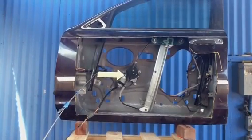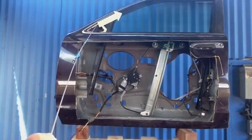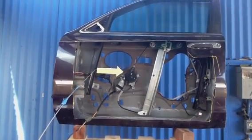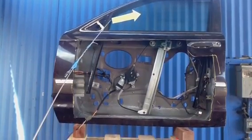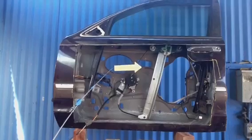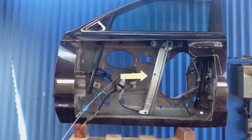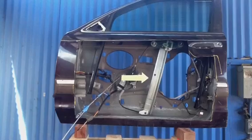What the chip does is count the revolutions of the motor as the glass goes up, learning how many revolutions it takes to reach the top. Once it gets there it remembers, and from then on it rolls the glass up to that exact height. It also has sensors so that if you or a child puts fingers in there, it stops and won't pinch them. But when you reinitialize, you have to go through what's called an algorithm — a complicated series of steps. You either need an expert in auto electrics who can look it up, or you have to call the dealer. We've had to do this many times — it's difficult to get this information.